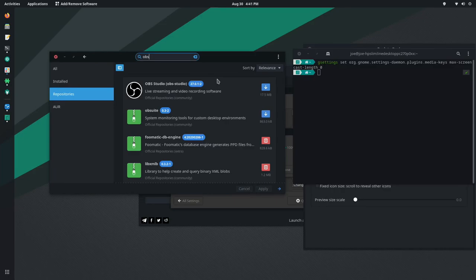Apparently, the AMD cards are awesome for gaming. They're trash when it comes to anything for video encoding or anything in that area. So if you want to do video encoding, I suggest either just leave it an Intel processor in there. Ryzen will not help you, really, unless you're going to do CPU encoding. But if you're going to record the screen while also doing something like pro audio, I really would suggest, if you're not against the whole proprietary driver thing, grab an Nvidia GPU like a 1050 or something. You don't have to have a super powerful one to do this, but like a 1050, 1050 Ti, or a 2060 or 1660 Ti, maybe a 1650.